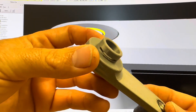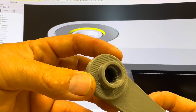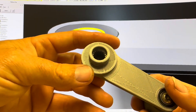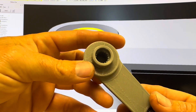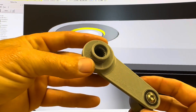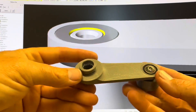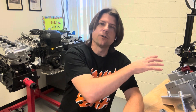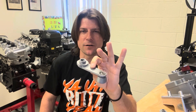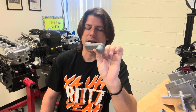One problem I ran into when 3D printing this is that I'm unable to create an actually sharp corner on the inside of the spline because I'm restricted by the nozzle size on the 3D printer — it's always going to have a radius the same size as the hole in the end of the nozzle. So this is going to get me pretty close for fitment on the car, but I'm probably going to have to do final adjustments to that spline size once I start machining the aluminum pieces. I'm going to get the material ordered to make some of these and I'll probably have one knocked out by the end of the week. While I wait for my one-inch breather filter to show up for the catch can, I'm going to continue working on these window cranks — I've got lots of programming to do. I really want to get one of these prototypes done by the end of the week, and if it goes super smoothly I might even actually release these before the end of this week.